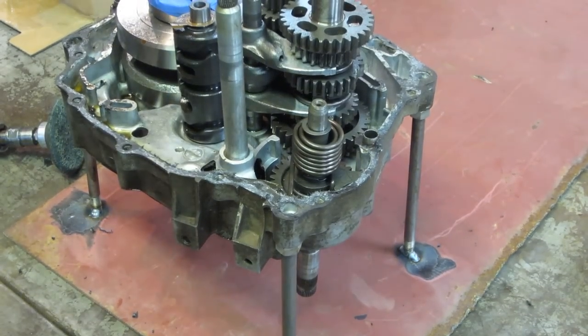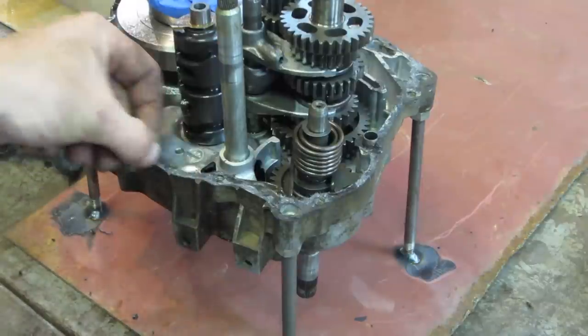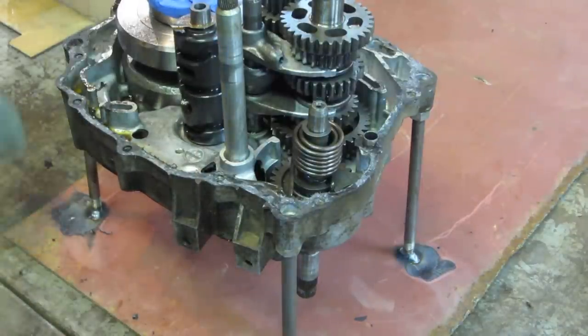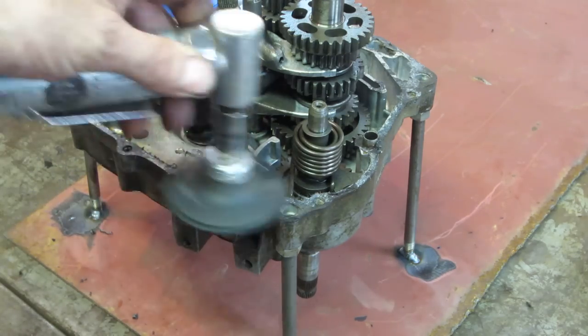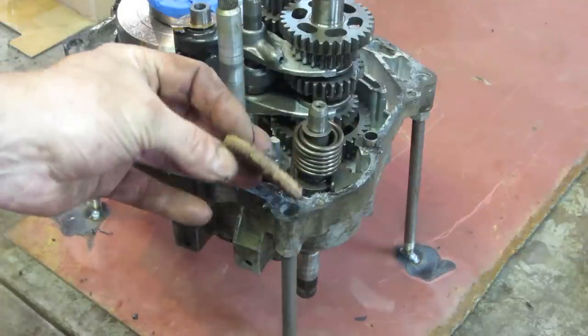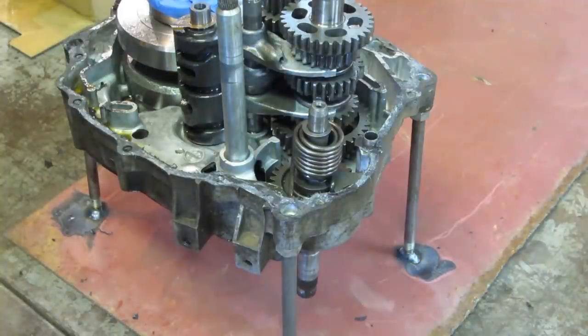So that stuff's on there pretty good. I hit it with a scraper, but you're not gonna be able to just scrape that off of there. It's gonna need something. So we're gonna try a Roloc Scotch-Brite disc and we'll see how that works. I got a couple of different grits. I gotta go change out the head, but I also have the brown, which I think is more aggressive. But we'll give that a shot.